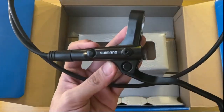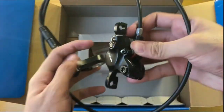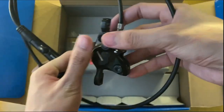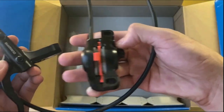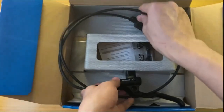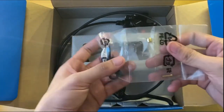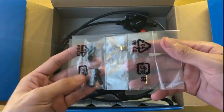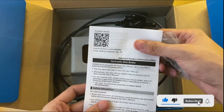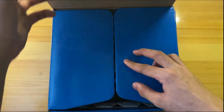For better performance of this brake set, use the Shimano mineral oil. The caliper of this brake set is dual piston and compatible with 160mm and 180mm brake rotors. Please read the user's manual if you are new to this product, or you can visit the Shimano website. I'll put down the link in the description below.